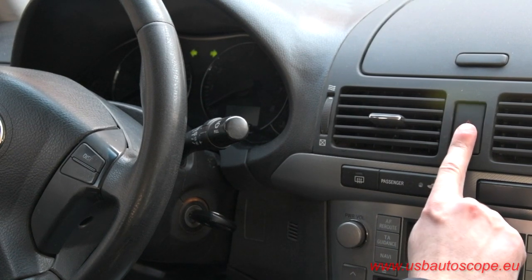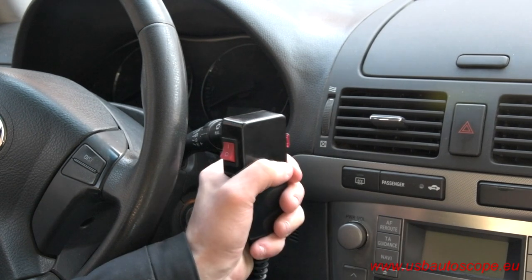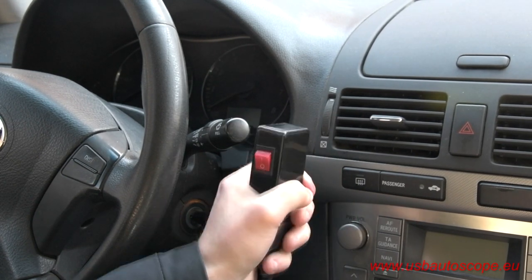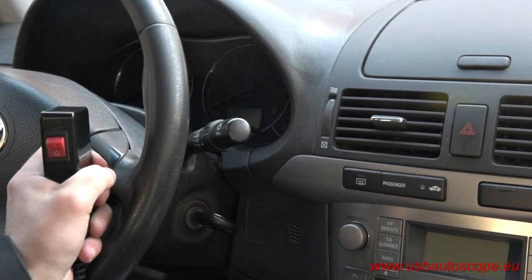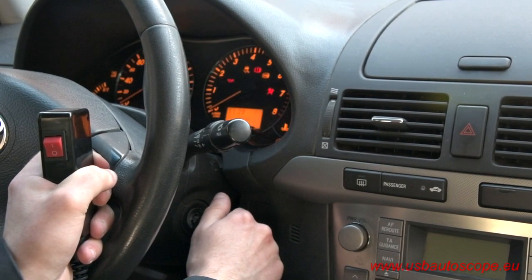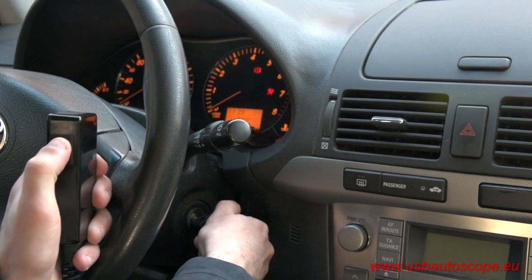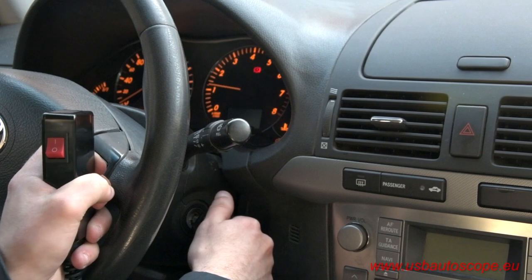Turn signal lamps on for 3 to 5 seconds, then turn them off. Turn off the previously installed test switch. Turn on the ignition and wait a few seconds for the fuel pump to shut back off. Crank the engine for 3 to 5 seconds, then turn the test switch back on. The engine should start.